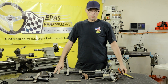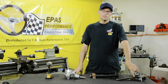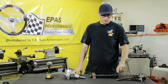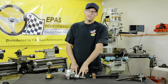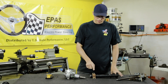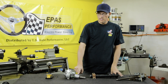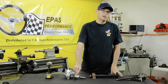Now that everything is cut, the lock mechanism and double D is going to be reinstalled in the upper part of the steering column, and then you're going to tighten both bolts. Then we're going to put this on the end of the electric motor and tighten both set screws. This is going to take some effort because the steering shaft inside is loose to get it into the double D. After that is done, leave the steering motor adapter loose for clocking after we put it back in the vehicle.